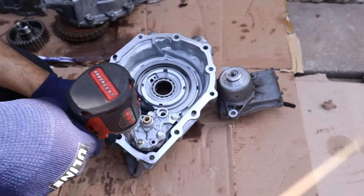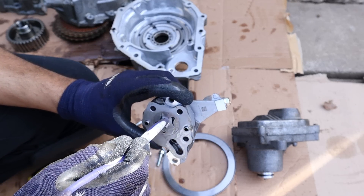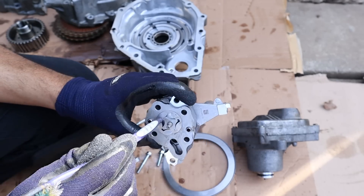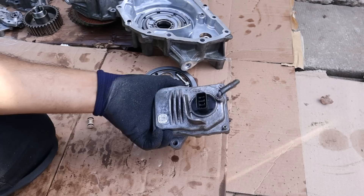Let's look at the oil pump real quick. Here's the oil pump — yeah, it's actually two little oil pumps. It's more of a gerotor-style oil pump where you have a small wheel on the inside driven by the electric motor, and that rotates inside of the housing creating fluid flow. The input of that is this little slot here, which is controlled by the electric motor.